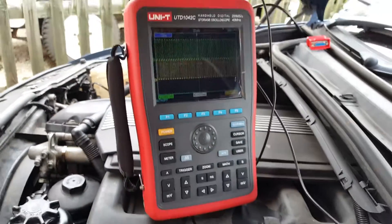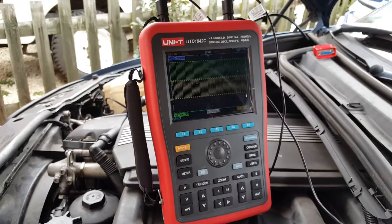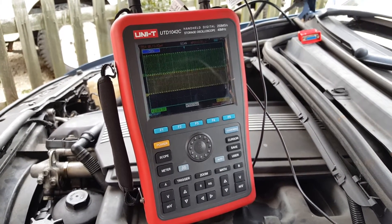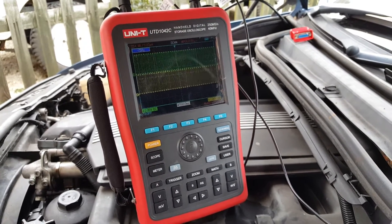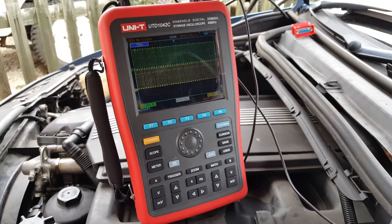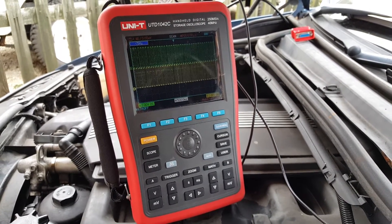And that's how you can check to make sure the ECU is actually reporting the correct codes. If you've seen my last videos, you've seen a C4 that I did where the crankshaft sensor was actually faulty, but the code the ECU was giving me wouldn't tell me anything about the sensor. Luckily I could see on live data that the sensor was not reading. In this case, you cannot see on live data what the camshaft sensors are doing, so this oscilloscope method will be the way for you to check.